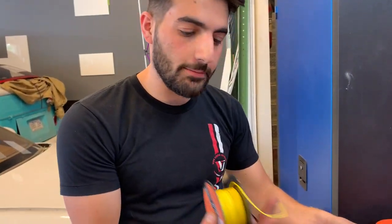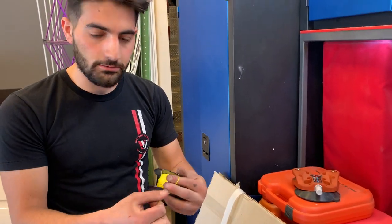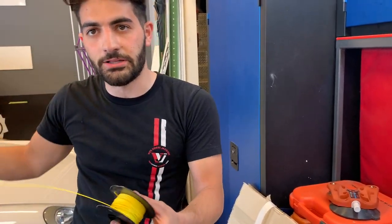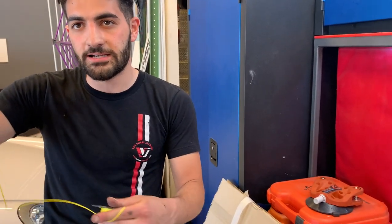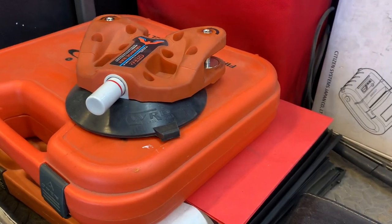Basically, I wrap this wire around. It's non-metal and very easy to bend. We put the wire around the glass completely, and then I start to crank it around with the drill. The line goes towards the frame instead of towards the glass. It puts less stress on the glass, and therefore I can save the glass.